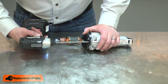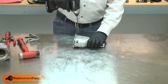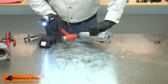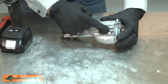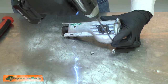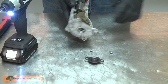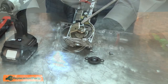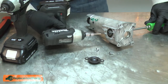It's secured with a plate and two screws. Now I'll open the gearbox. On the backside of the gearbox, I'll remove the bearing cover. Next, I need to remove the screw that secures the crankshaft. If I try to rotate the screw, it'll just rotate the crankshaft as well, so I'll insert a screwdriver between the counterweight and the connecting rod, and then I can remove the screw.